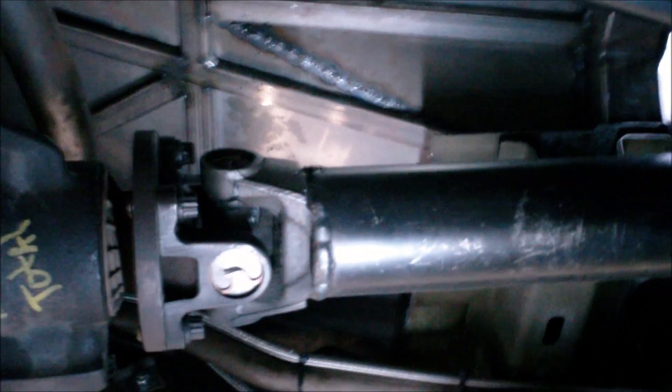For the rear suspension we've got a bag-on-bar setup. I always try to get the bag on the bar versus over the axle — it rides a hundred times better. A lot more work but definitely worth it. Our wishbone up top is mounted on each side of the driveshaft and goes back, giving us as much triangulation as we can get into it. There's a bar wrapping underneath the driveshaft and also a bar going over the driveshaft to each upper link, making a big old wishbone. This thing handles great on the road.